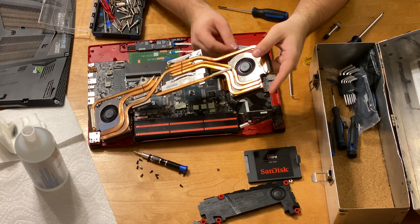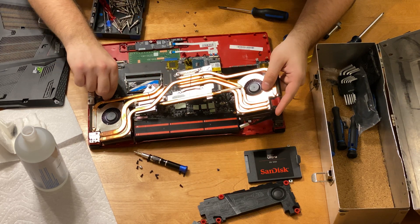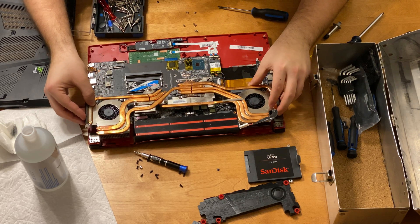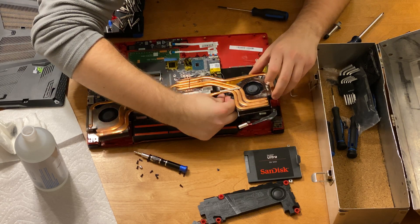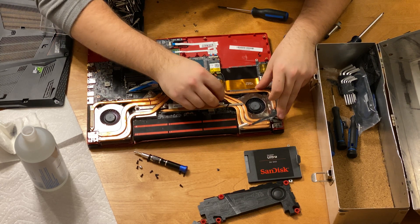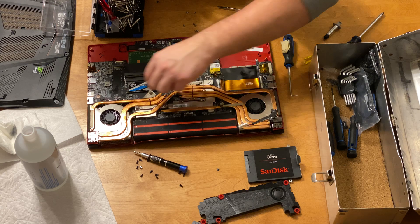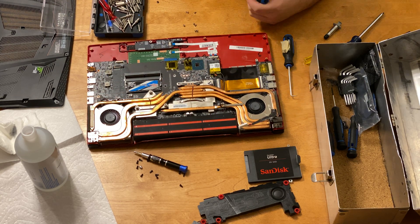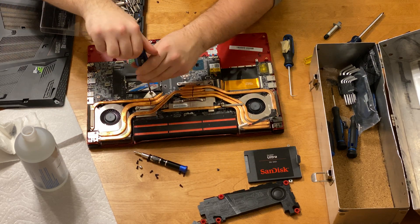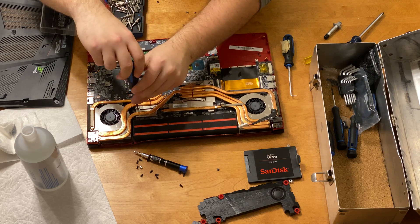The next step was to clean the chips. MSI did a really nice job of applying the thermal compound — it was spread evenly on the metal surface of each of the GPU and CPU chips, which means I was getting very good contact between that and the heat pipe. I'm still going to upgrade the compound because I bought a more expensive one which should be better for longevity. These heat pipes were easier to clean than the MacBook Pro ones, which were very thin and delicate — the MSI assembly is very heavy and sturdy.